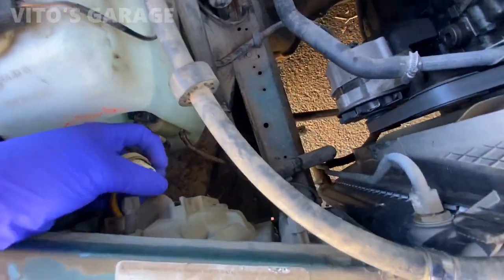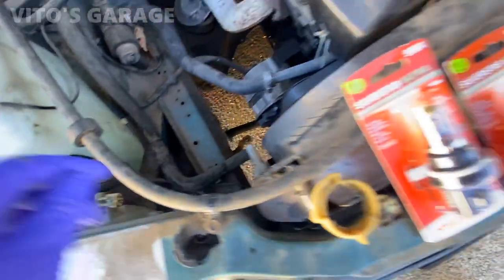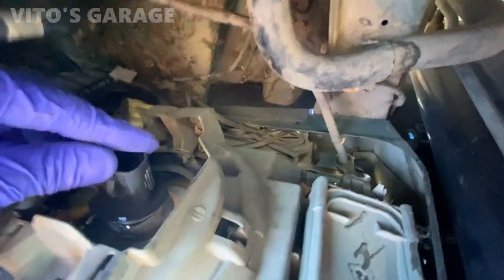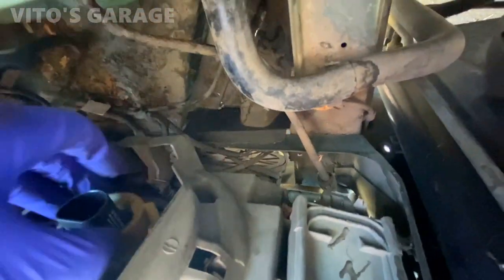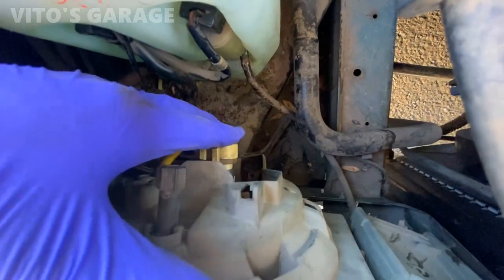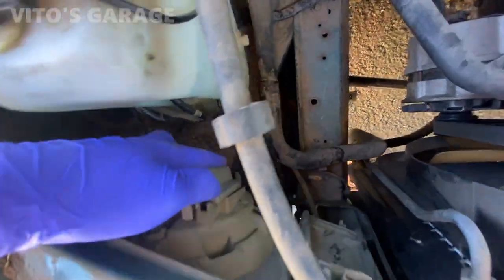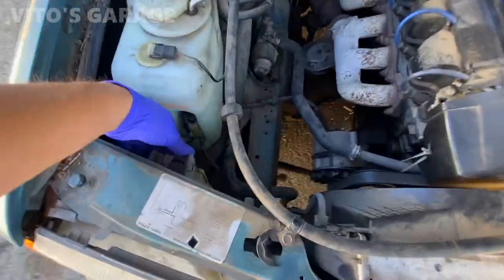I already had this one disconnected. This one's a little burnt up, which is not good, but I'm gonna make sure there's no corrosion in there and that it's all working properly — the old bulb was literally just burnt out. Install the bulb, wiggle it in like that, and then the ring — don't forget the ring. There you go, the ring is on, connected, perfect. So easy. You can't do this with brand new cars; if you want to change the bulbs on new cars, good luck — you'd have to remove the front bumper and the whole headlight assembly just to get to the bulbs. These old cars are amazing.